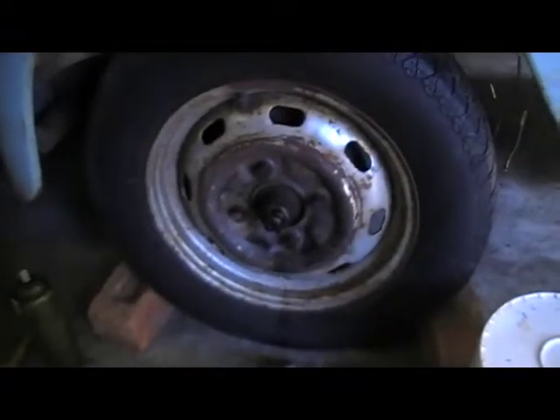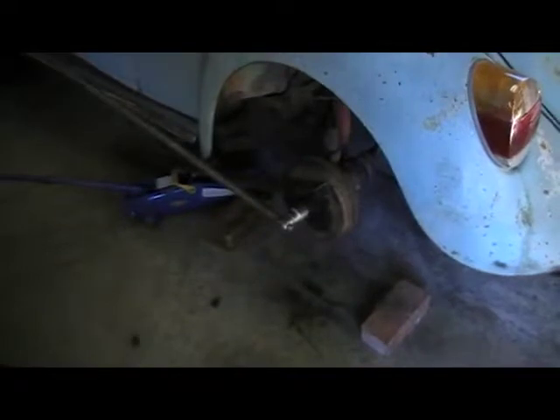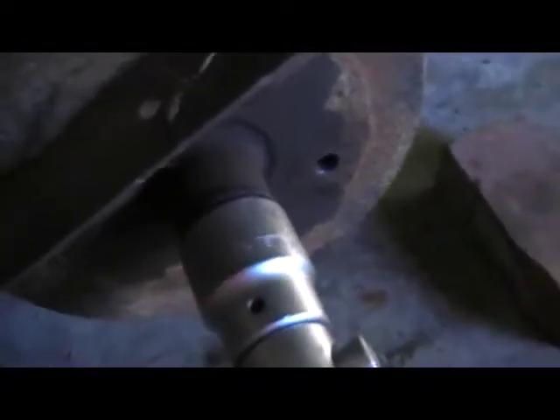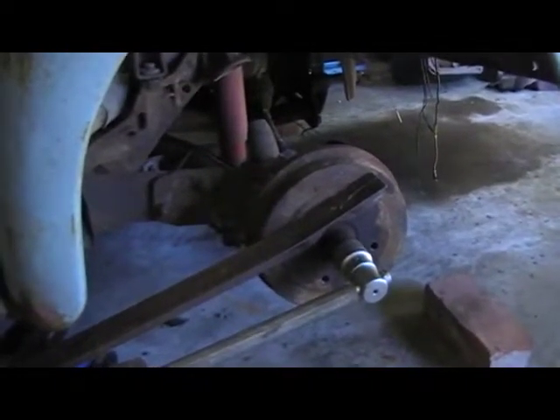As I suspected, it is really tight and rusty, so just try a little bit of heat first. Maybe a crack with the big breaker bar. My camera battery decided to die in the middle of that section — I was having no luck with the rattle gun. Plan B is always to bolt the helper bar to two of the axle bolts with the big three-quarter inch breaker bar, and me jumping on it. And it finally cracked. Just waiting on that nut to cool down now so I can take it off.